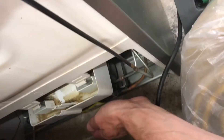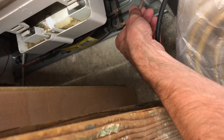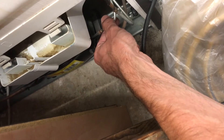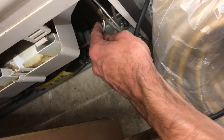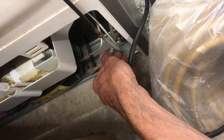It'll probably turn on in a bit because opening the door will have let heat in. So I've just replaced the freezer potentiometer and turned it on about 10 minutes ago. The compressor has now kicked in, and the suction line is ice cold.